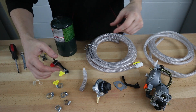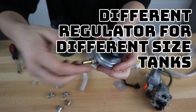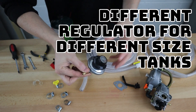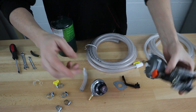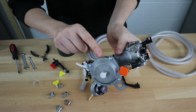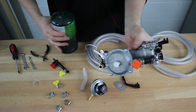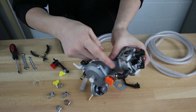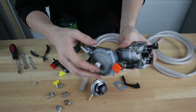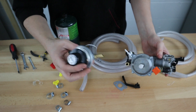Let's take a look at the parts we need to get this going. First and foremost is going to be your regulator. Without the regulator, your propane is just going to be leaking out into the atmosphere. There's enough pressure inside of even one of these little one-pound propane tanks to push the gas right out the top, and you're not going to have any way to really stop it. So pick up your regulator — this is for one pound.